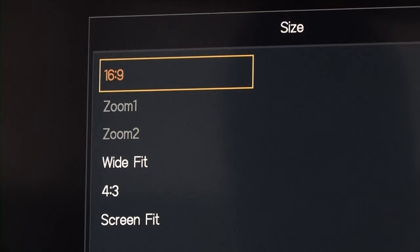Most TVs today come in widescreen format, so you also want to go into your TV settings and ensure that you have the proper size selected. For the widescreen, you want to use a 16:9 ratio. Additionally, if there are any resolution settings available on your TV, you want to set it to the maximum resolution available. That will typically be 1080p or 720p, which are two high-definition resolutions commonly available today.